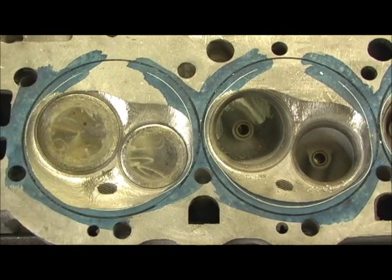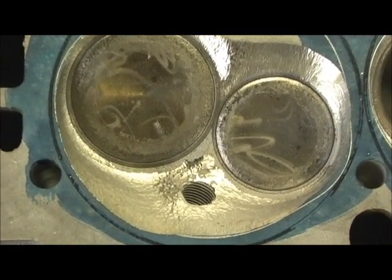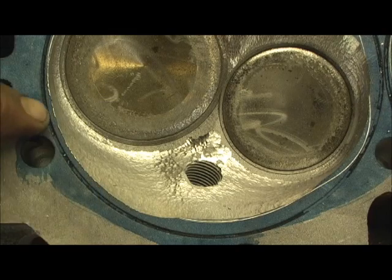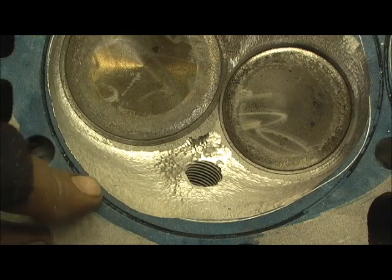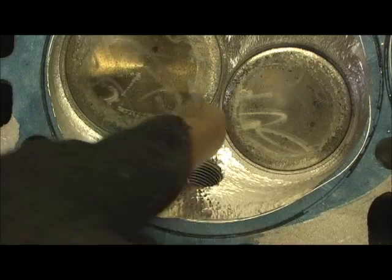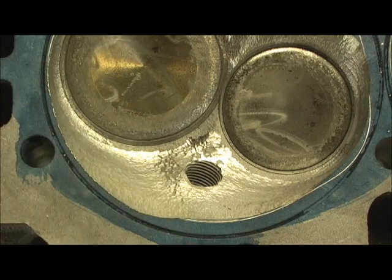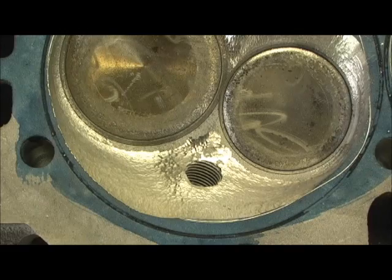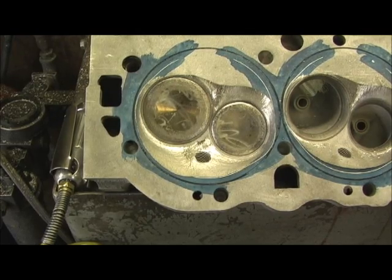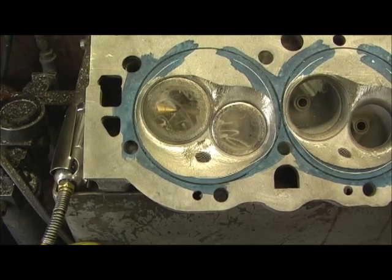I thought that was a pretty good swoop. Let's get a little more straight-on view of that chamber itself. There's 110 thousandths of ridge right there, which is more than enough support to hold the ring. This swoop right here, this exit — there's nothing in the way over here keeping it shrouded, but right here there is. Anyway, that's the major chamber mod done. That ought to help quite a bit. I'm going to go ahead and do what I need to do on them and then polish them. And then we're going to roll over to exhaust — you're not going to believe what I've got to do there, and this is an optional thing for my customer in one area.